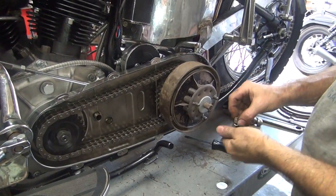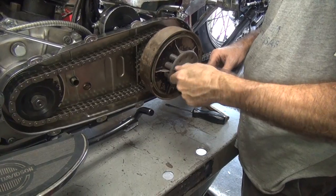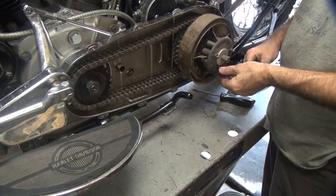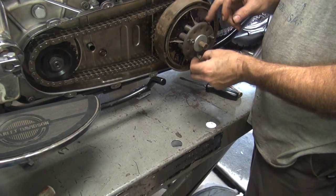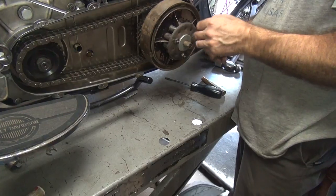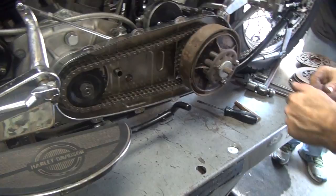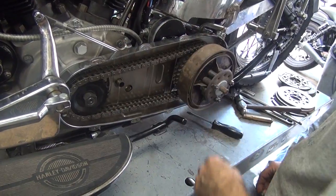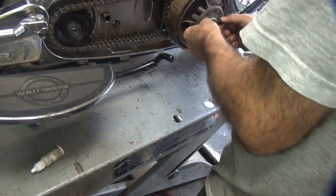Now these are the '68-and-up springs, Dan. The early springs are real short and heavy — they're for a foot clutch. Also for a mousetrap. The earliest fat springs — I won't use them. These springs can come out until '68. You're telling me the long springs are the ones for the mousetrap and the short stubby ones are the ones for the foot clutch. But the mousetraps use the heavy springs too — that's how the mousetrap works. It's the hand clutch that takes the light spring. Also the five-plate clutch takes a light spring, unless you've got a lot of horsepower, then you use heavier springs.